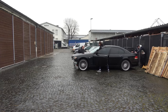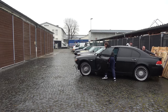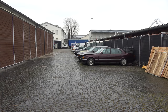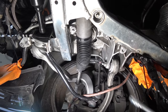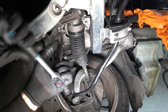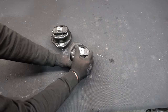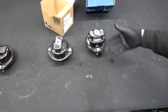Time to get that turd in. Come on, Alpina — move, you bastard! It's so slippery by the tire. It's in! Well, I did forget to move the camera, but the car is in. Now we're going to replace the engine mounts — the right one is not too bad, but the left one is shot. It shouldn't move that much and make that sound. Here's one — original part. And another one — OE part. Only one was available as OE; the other one I have to get from the dealer.